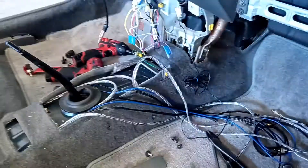Alright guys, so we've brought all the wiring to the amplifier — got power, remote, ground. Grounded it right here to this post, stripped off the paint, put two screws in there in case one wiggles loose so you have the other one. The power wire goes to the front, the rear speaker and sub wiring goes towards the back, and we've got the RCAs hooked up right there. We're going to guide the rest of the wiring up towards the stereo, through the bottom of the carpet, up to the stereo area. And we've got the epicenter control knob wiring here — we're going to install it right up here by the emergency brake.